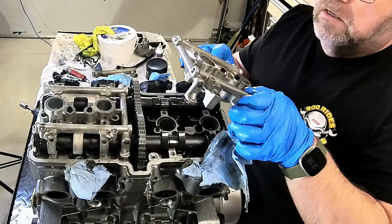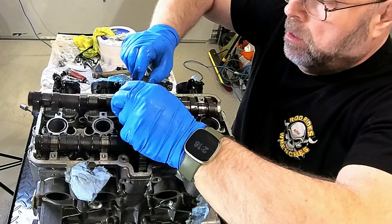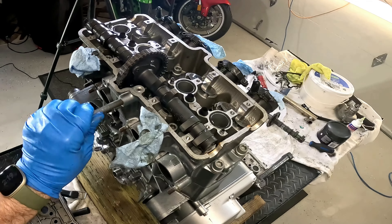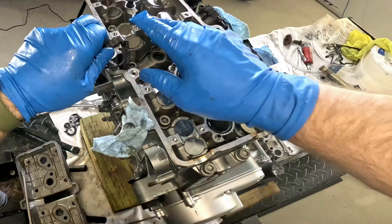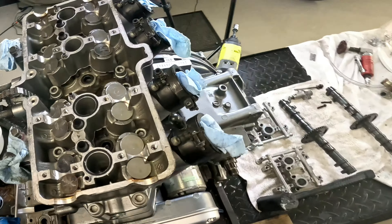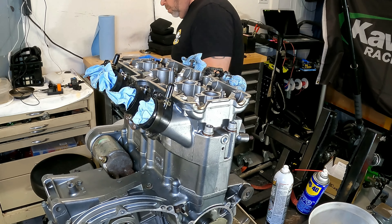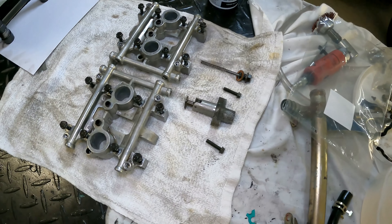The camshaft keeper can be removed and I'm leaving the bolts in place in their respective positions. It's time for the camshafts to be removed starting with the intake cam, which is my preference since this is where the most slack in the cam chain is once that tensioner was taken out. Following the intake cam is the exhaust cam. Hold on to the cam chain while removing that last cam — you don't want it dropping down into the engine. Secure the chain to a point and keep it out of the way. Here I'm using some cable ties and a bolt on the front of the engine to help hold it in place. Once the cams are out, it's okay if the chain or crank moves a little bit, but if you do need to move that crankshaft, make sure you hold that chain with some tension so it doesn't kink or get damaged down in the crankshaft.